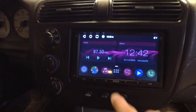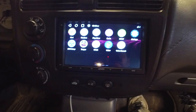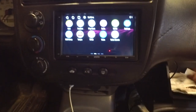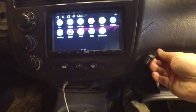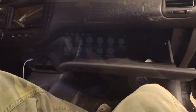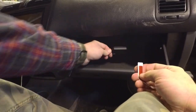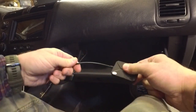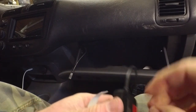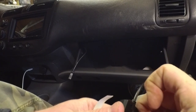Here on the head unit, if I go into the applications, there should be one already in here that says TPMS. Again, if you buy the universal kit off a thumb drive, you just plug it into the USB port on the stereo. I always run a spare USB port into the glove box, and this is actually where we're going to be plugging in the receiver — it just plugs right in there. What they recommend is to use the included double-sided tape and mount it in the glove box, which is what we're going to do to allow us to plug it in and unplug it if we need the USB port for something else.